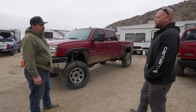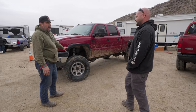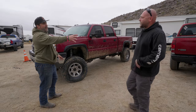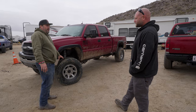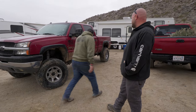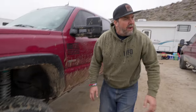It's an inch-and-a-half wheel adapter. I drove it to Washington three years ago, lost a wheel bearing, and the idea is that if you have an eight-on-170 wheel bearing you can get it at any auto parts store anywhere. With a redrilled hub you're stuck and have to call us to get another one. The wheel adapter was about $150 on Amazon. So — six-inch kit. What did you do for the transfer case?